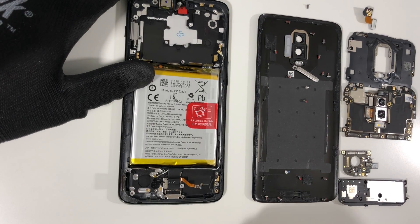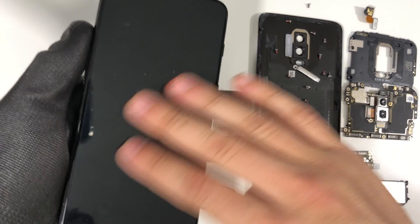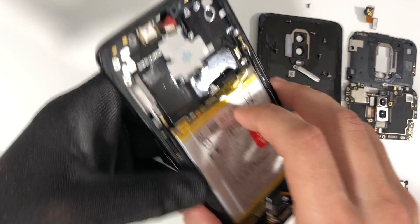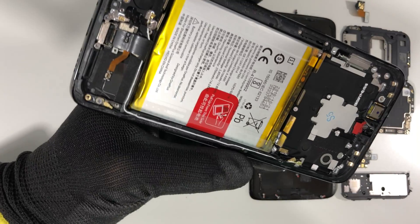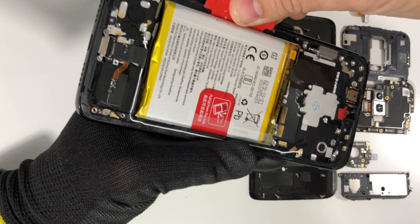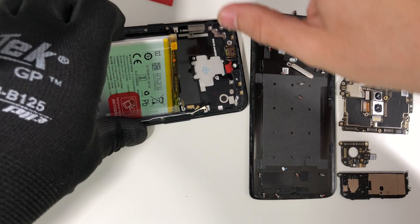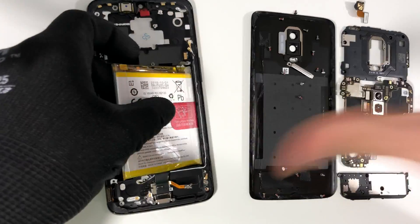Next, let's remove the battery. To do this we need to apply heat again, but this time on the front section of the phone on the screen, so that it can loosen up the adhesive holding the battery to the frame. Once the phone is hot enough, grab it — make sure you don't heat it too much so you don't damage the LCD if it's not broken. Stick a prying tool in between the frame and the battery and wedge up gently — the adhesive will begin to release. Once most of the adhesive is removed, grab it with your fingers and gently pull the battery up and remove it from the back frame.